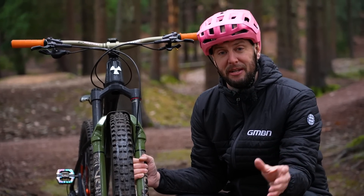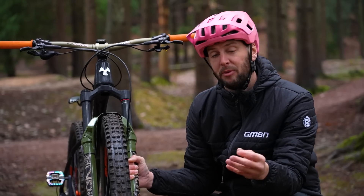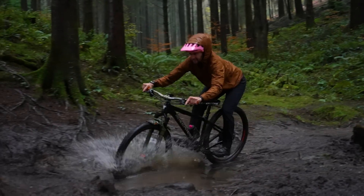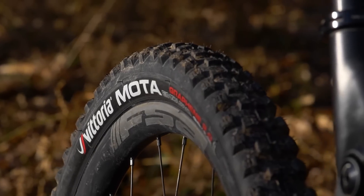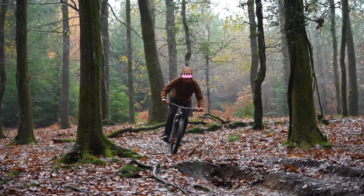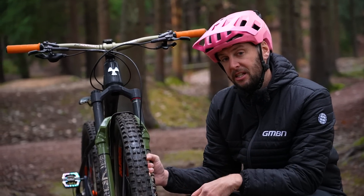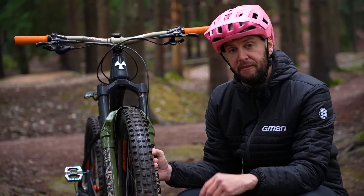Let's dive on in because first up, it comes to tire choice. Summer tires and winter tires are very different things. In the winter, it's going to get all sloppy. Those dry, dusty trails are going to turn to mud and doom and gloom. A more aggressive tire with a wider spread out tread pattern is going to be ideal here, preferably with some slightly higher profile knobs, because this is going to be great for cutting into the mud but also shedding the mud as well. A lot of people ideally would switch out the front and the rear tires, although you can get away with sometimes just switching out the front tires so that you've still got that most grip possible on the front end.